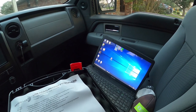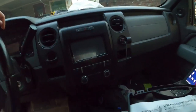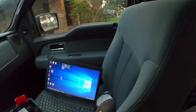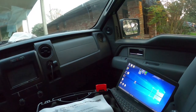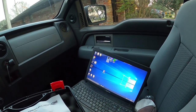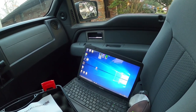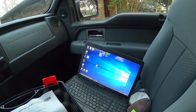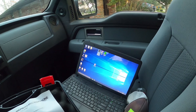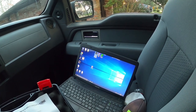Don't be alarmed — your first reading is gonna be all over the map. That's where you get to work. This radio has some decent features for tuning, but basically you're gonna want a parametric EQ, which I have in the form of a Dayton DSP 408. It's the best budget one I could find — there are more expensive ones out there, but for a basic down-and-dirty system this is what you want. It's $150 and has 10 bands per channel, so it's ready to go. If you follow this process, your system will sound better — it just will.